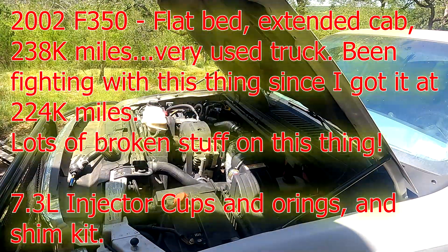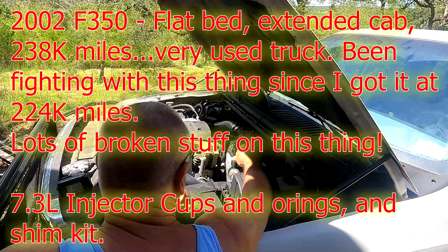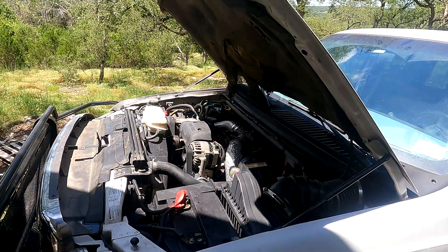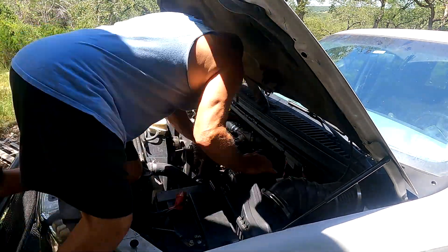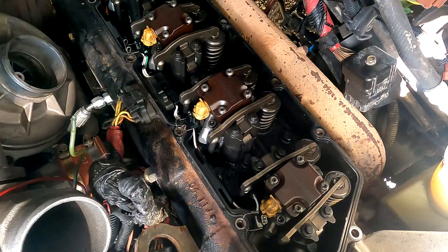Hi guys, this is VTEC with Blueberry Hill. We're doing something a little different today — we're actually fixing the F350. It's a 2002 with the dreaded injector cup failure. It's got a cracked injector cup that's been bleeding oil into the combustion chamber on one or more cylinders. We're gonna find out how many — possibly two. I did find one really cracked one and one potentially failed o-ring, which was probably bleeding oil into the cylinder, making it really hard to start.